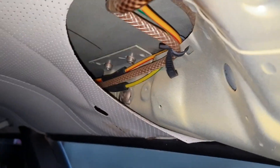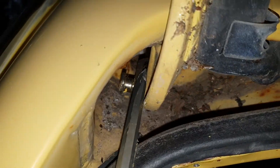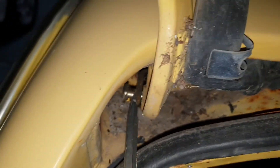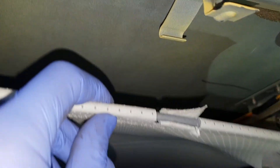This little piercing in the roof liner does not permit access to the screw — I'm not quite sure what it was for, but if you try to get it through there you will tear the lining. To start, just remove the little circlip on the retaining bolt, then the bolt can be skewered out in an outwards direction. You can see the little clip which you simply flick off the roof lining to pull it down, giving much better access to the 8mm Allen bolts.